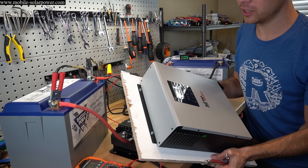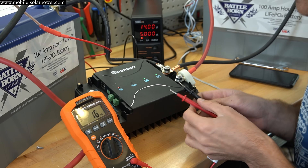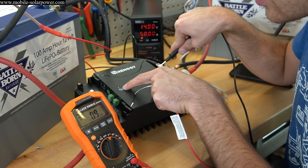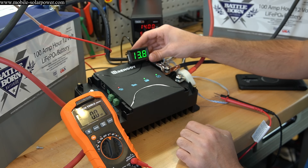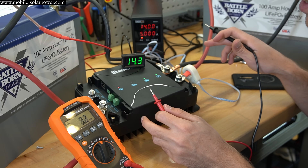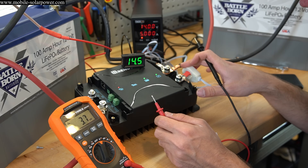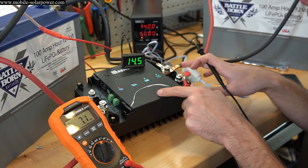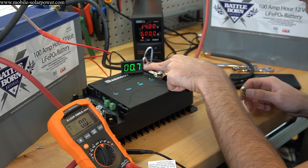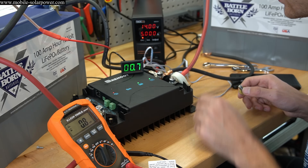Since I'm impatient, we're going to use an all-in-one charger to charge up the starting battery. Now it's charging and we already have 13.07 volts with a red light at the alternator indicator — and amazingly, it started charging at 13.8 amps already. To get a better test, I'm disconnecting the solar battery for now so I can have it extremely discharged while the starting battery is fully charged, to see the maximum power we can push through this unit.